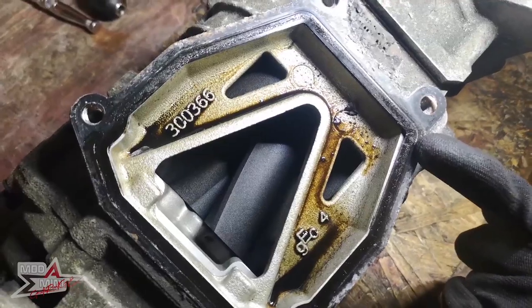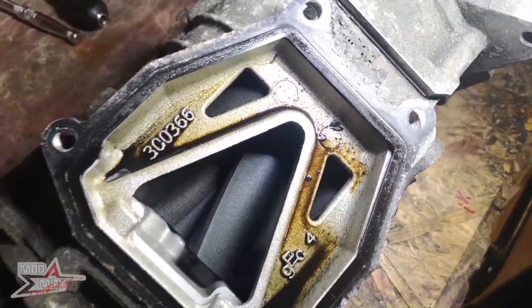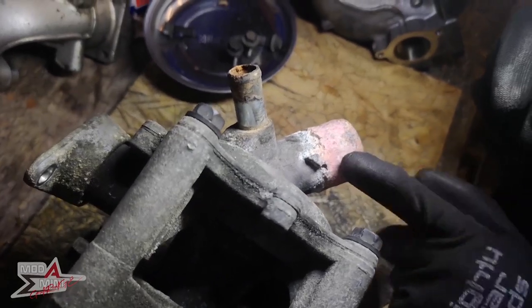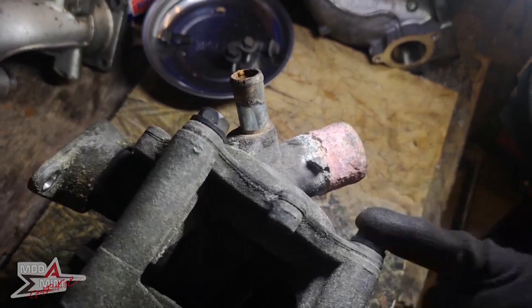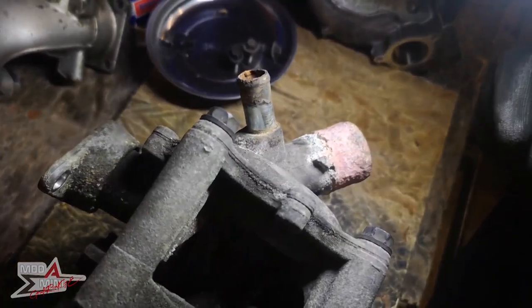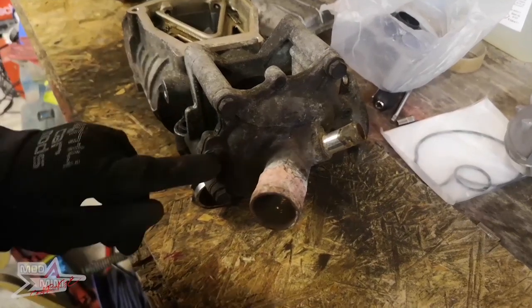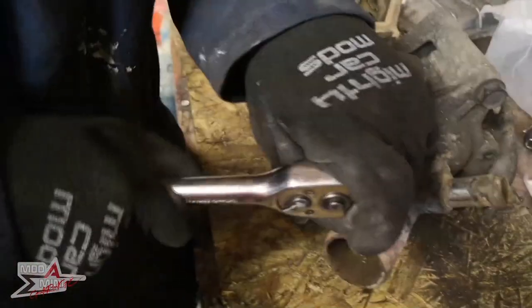This gasket also looks like it has seen better days, so it may also be worth replacing that. The other part that we're going to do though, in the meantime as well, this is off, is to replace the water pump, which also looks like it has been happier before. So it will be these four here at the end. So apparently I can't count four. There is just these three and they are all 13 mil.